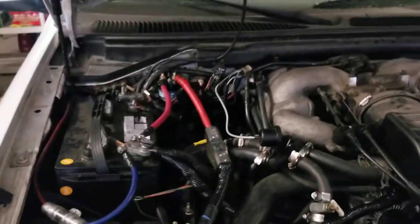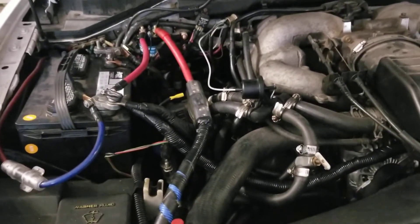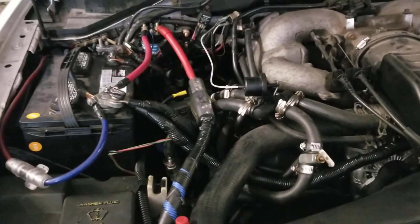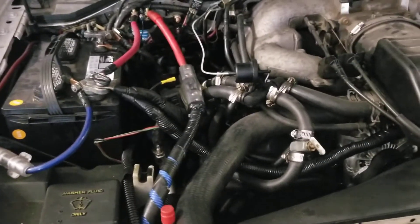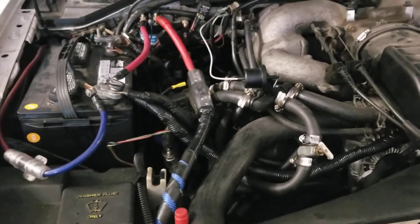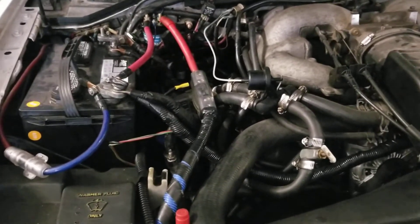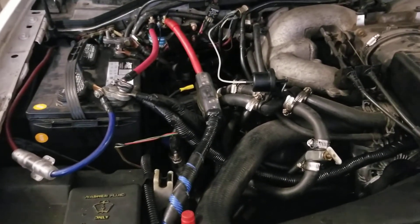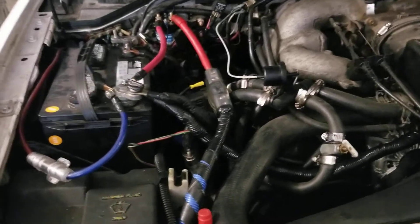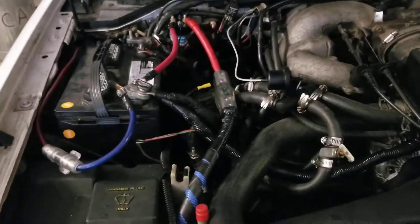The reason I took so long figuring this out is because I'd take it out and have it bench tested, and sure enough it says 300 amps. But what I since found out is these guys selling 300-amp high-powered alternators on eBay — they're really not 300 amps at idle. As long as you're driving, maybe you'll get max output, but you might get only about 50 amps at idle. That's not even enough to power everything. Even a normal OEM alternator would probably do better.